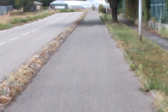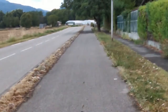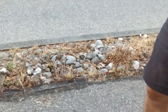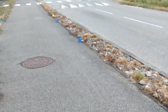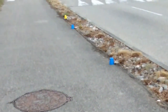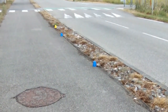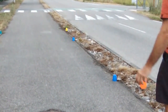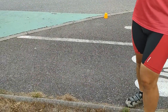Right down at the far end — at 30 psi — you can see that's the furthest lamp post and the bushes marker. That's definitely too low. So there is a clear effect, and it seems the ideal pressure is somewhere in the 80 to 90 psi range. You certainly don't want to pump up to 110 when the tyre's max rating is 104.